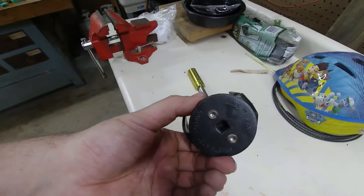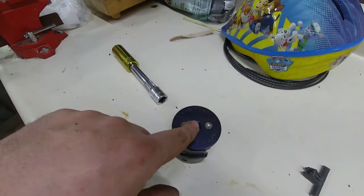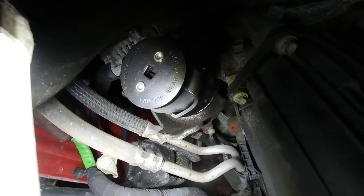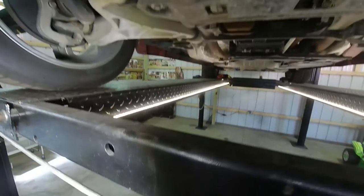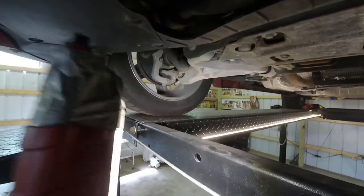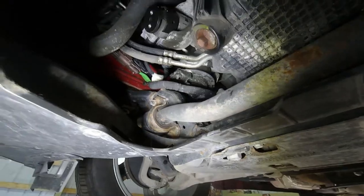To get the old oil filter out, I have an adjustable oil filter remover. Expand it over and onto the oil filter top — it takes a 3/8 drive — and then turn it counterclockwise to loosen the filter. When you loosen it, it will grip down onto the filter and it should come off. There is going to be no way to do this without some oil going everywhere, so do your best to get your catch tray into position and have a rag or two ready. I'm going to have to do this off camera.